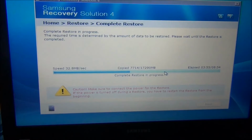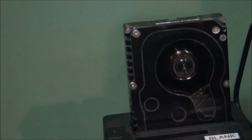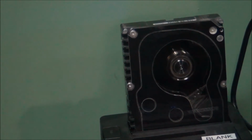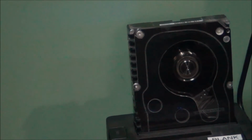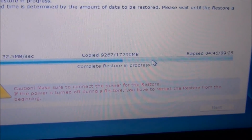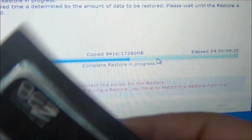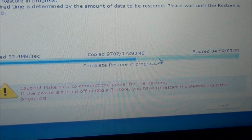And even if you don't have SATA 6 gigabit ports on your particular laptop, it's still going to be better than that old crunchy, regular mechanical hard drive like this one here that's crunching like crazy. I'm writing some files to it right now. That's typically what your hard drive looks like. It's a bigger 3.5 desktop hard drive, and the laptops take a 2.5 hard drive. But you see that moving head? You've got moving parts in a regular mechanical hard drive versus the SSD, where guess what? There's no moving parts. Less heat, less chance for damage. Look, I could do that and this thing is not going to get damaged. Versus if I did that with a mechanical drive, oh my, I'd be really pressing my luck.